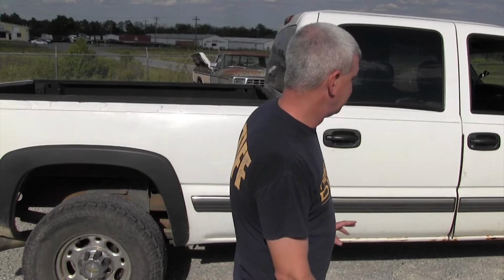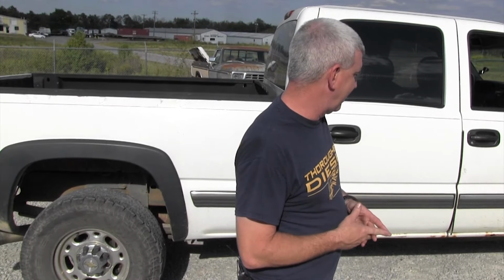Absolutely. The Allisons, everybody knows that the Allison's a great transmission. You know, they are not as good in stock form about holding power like some of the other ones out there. A lot can be done to that. There is tons and tons of aftermarket products for Allison transmissions. You know, obviously full transmissions, valve bodies, torque converters, a lot of good companies out there that are doing upgrades for those. If you're going to try to make power on the truck with an Allison, I definitely suggest that you address that first off and get your transmission shored up before you start trying to make power on it, because it's just not going to have anything above 500 horsepower. You're going to have problems out of the transmission in stock form.